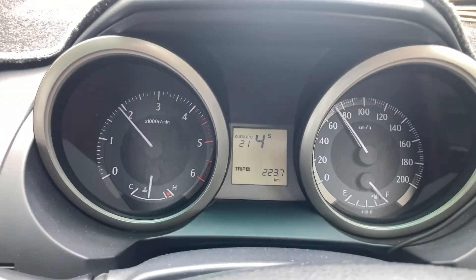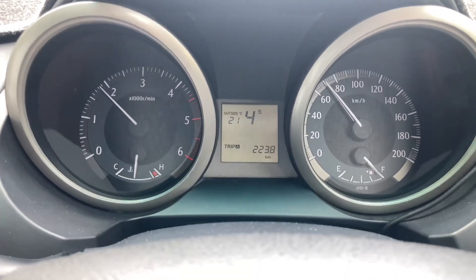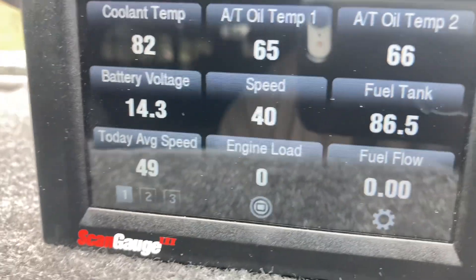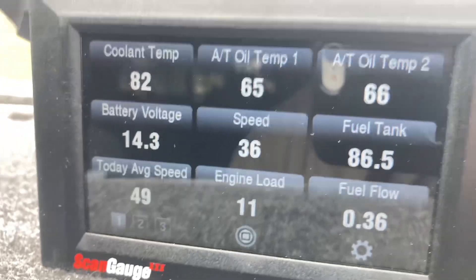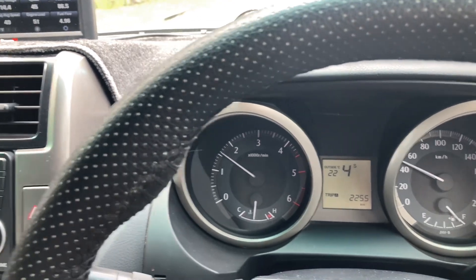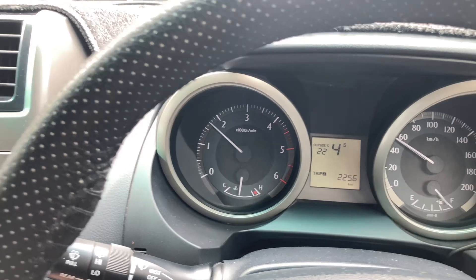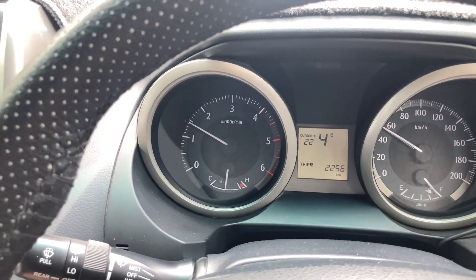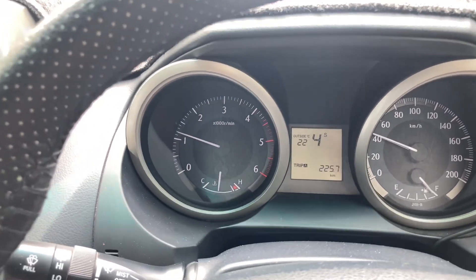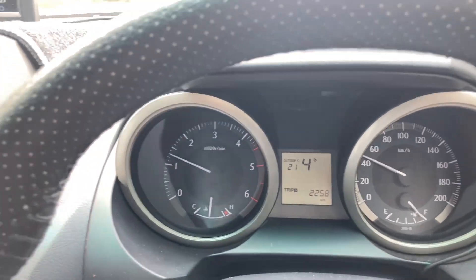Then you want to go for a drive down a normal road, the normal way you drive, at normal sorts of speeds, on a normal sort of temperature day, and see what temperature you get. Sometimes temperatures will actually drop when you're off the gas cooling down, coming down a hill, or in cooler temperatures. As my best example: it just consistently runs at 83, and I haven't seen higher than 85. Stock standard — no bull bars, winches, or anything blocking the airflow. You're going to have different results with an old dirty radiator or a modified front airflow cooling system, so you need to make allowances for that.